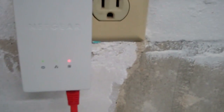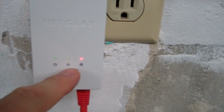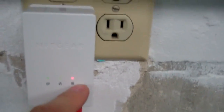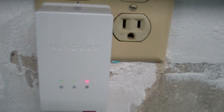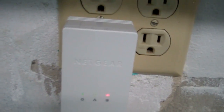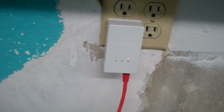It's a nice little feature: when you plug it in, you'll get a green light on the power. When there's something on the LAN, you'll get a green light in the center position. On the right, there's actually the nicest feature — a three-colored LED that can be green, yellow, or red, so you can plug the mating module into different outlets and see which one gives you higher internet speed. Right now we're red, and that's something I'm going to try working on.